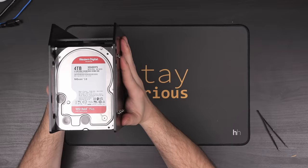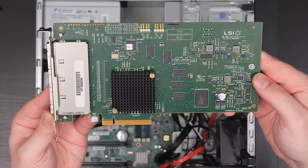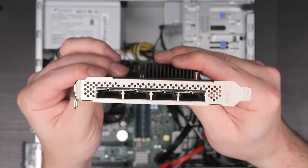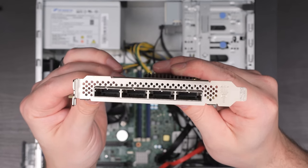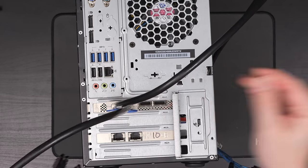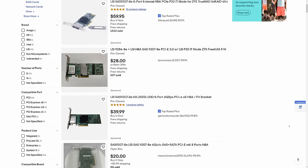Now having a stack of hard drives is cool, but how do we connect those to our PC? That's where this comes in — this is an HBA or host bus adapter from LSI, and it would typically be used in a server to connect to an external disk shelf using these MiniSAS SFF-8088 connectors. Instead of just using normal MiniSAS cables, I picked up these adapters which have 8088 MiniSAS connectors on one end but four SATA cables on the other. Each of the MiniSAS ports on the HBA can support up to four SATA ports each, so we'll only need to use two of them. You can also pick up a variety of two-port HBAs in half-height cards for smaller systems — but anytime you buy one of these HBAs off eBay, try to find one that's been flashed to IT mode, which is what you want for something like TrueNAS.